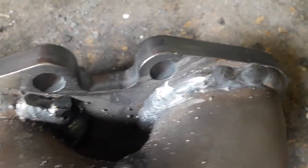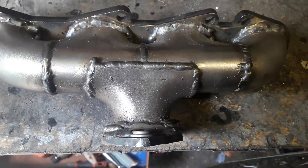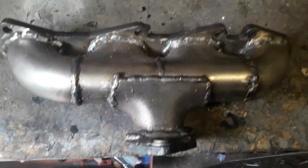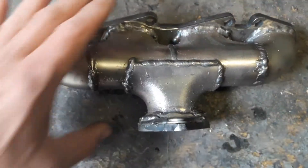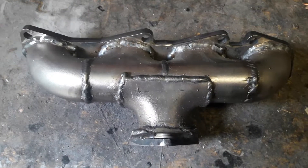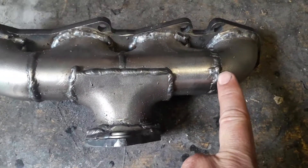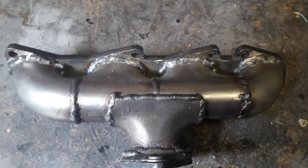As you can see if I zoom in closer on the actual welds themselves, they are certainly good enough to withstand the kind of heat this is going to see — potentially up to 900 degrees. The outlet for the turbo itself is in the center of the manifold, which is different to the standard layout. A standard one, and quite a few of the log manifolds I've seen, have got the outlet here.